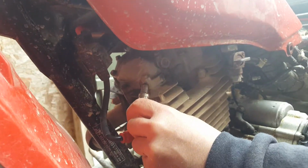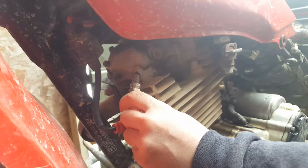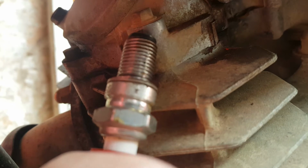And you turn the on switch on your bike and you hit the button, and there you can see a spark. Can you get around to see that spark in there, Leo, so that they can see it on camera? And there you can tell that the spark plug is working, the ignition's working, because there's a little bit of spark coming out between the points in there. So we're going to assume that we've got spark as the first part of our engine, which means now we're going to check for fuel.